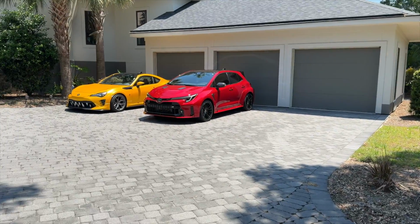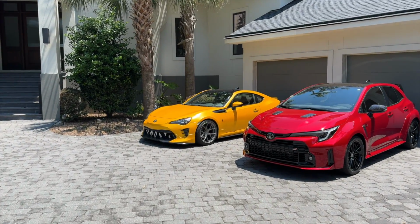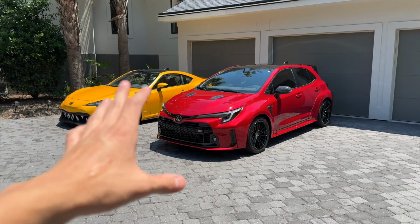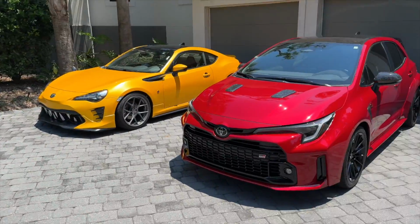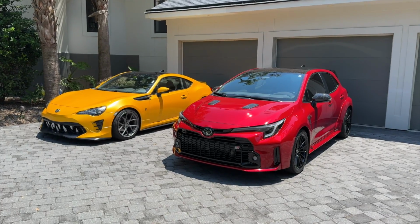But the thing about the rear-wheel drive car is you can do a lot of throttle control. You can steer the car very easily with simply the throttle, and with the steering wheel you can just play with it back and forth, toss it left and right, and you can balance it pretty well. With an all-wheel drive car, not only are your front wheels turning the car, but they're also pulling you. So you think you're counter steering, but you're actually also pulling the car that way. What I noticed with a rear-wheel drive car, it's kind of funny, is the way it slides is your back end kicks out. But with the all-wheel drive car, you just move left and right. It's really funny, and it has a learning curve. But I do think there is a balance to both, and it's good to have both cars because you get to play around with both and see how it's different, because they slide differently.